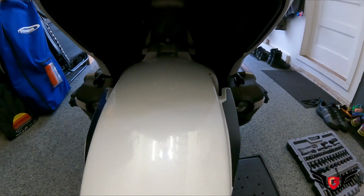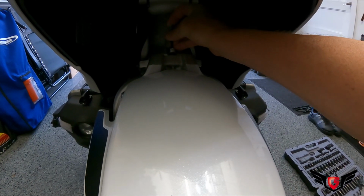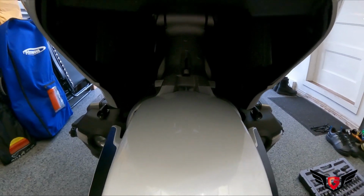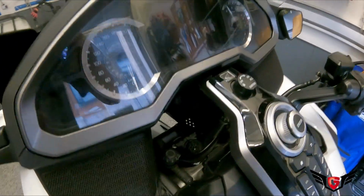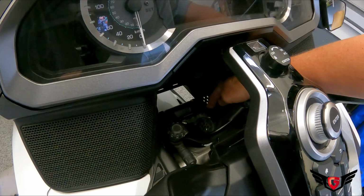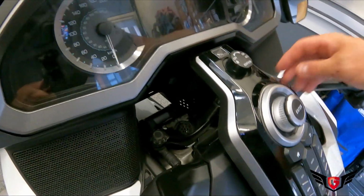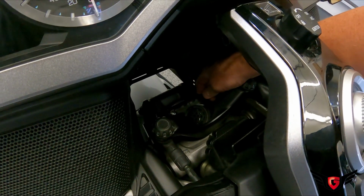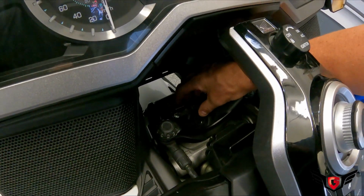You will see there's a place for locking up the wheel. So you simply insert a big nail through here, and you will lock the wheel in place. So with that lock, you go in the front, and you will see there's one 17 millimeter bolt here that holds the steering column with a 19 millimeter nut. So what you do is you just loosen the nut here by holding on to the bolt on the right, and that will loosen the steering column here.